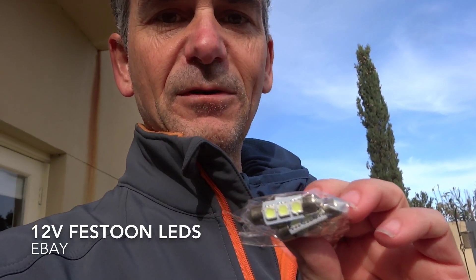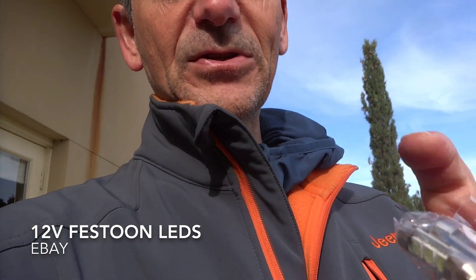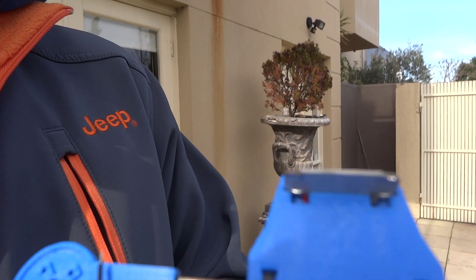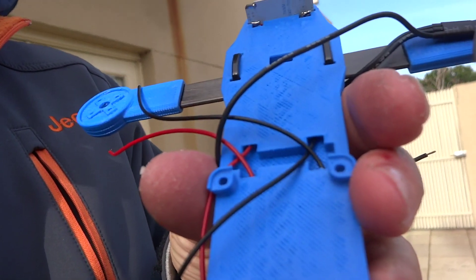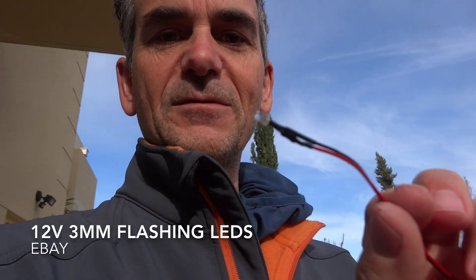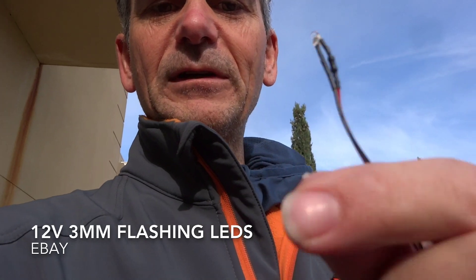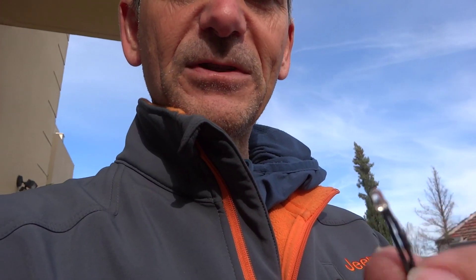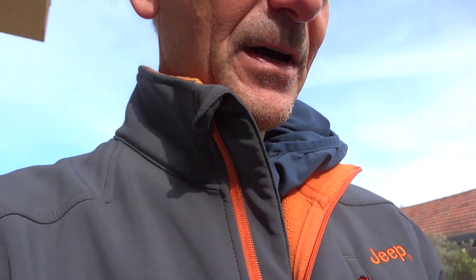What I've got here — I've fitted this out with these Festoon type 12-volt LEDs. It's just a matter of popping off the ends and then soldering some wires on. You can have a quick look here how I've done it. Then you just run those wires straight through to the middle where the distribution board is going to go. With the rear LEDs, we've got some flashing 12-volt LEDs — they've got the built-in resistor. I've put two of those in, but I've cut off one of the resistors.